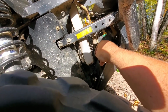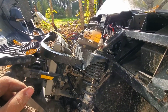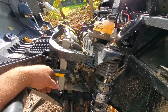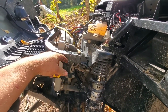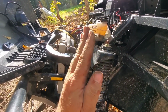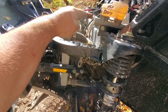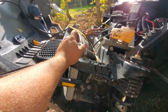I'm gonna put this back in. Probably a good idea to do this. Well, that plug came out hard. There's a whole procedure in the instructions on how to use garden hose water to force the air out of the new heater. Well, what I did, I took this hose off and I got it up here, which is definitely higher than the heater, because this thing is sitting at a pretty good angle. And I poured in this hose until it started running out of this. I'm going to go top off the radiator.